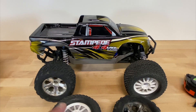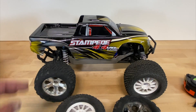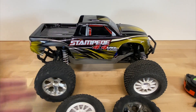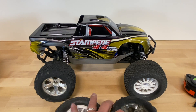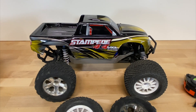If you run it as-is with a much bigger tire, you're basically going to be overheating the motor. It's going to be geared up too tall — it's going to accelerate a little slow. This is a good place to start. Once you get a baseline, do some temp checks on your motor, make sure it's driving okay, then you can play with the gearing up or down depending on what you want. Even just putting on big tires, you do want to adjust the gearing to match.